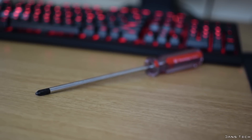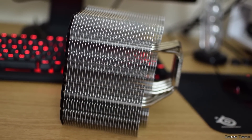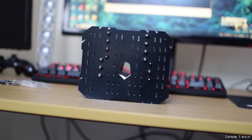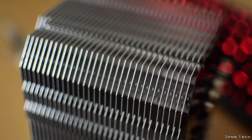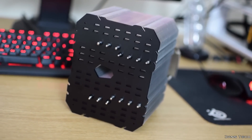You also get an instruction manual which is overall well written. Onto an overview of the cooler: the heatsink's dimensions are 150x125mm with the height being 159mm. The weight of the cooler with the fan attached is 1.06kg, making this cooler quite heavy indeed. The cooler features many aluminium fins, of which the top fin is black. The fins in general are quite loosely packed together, which may improve performance at lower RPMs and hints that this cooler is meant to be relatively quiet.